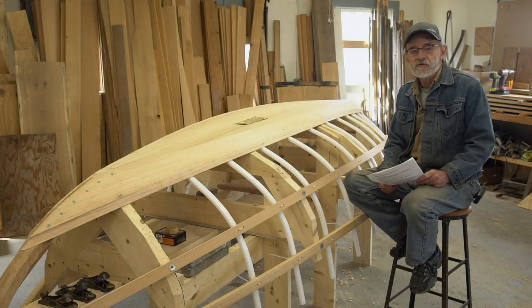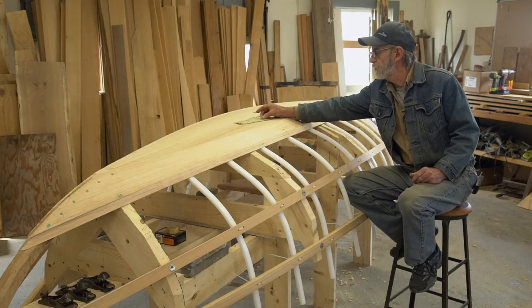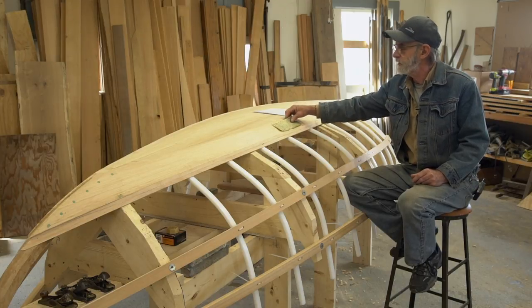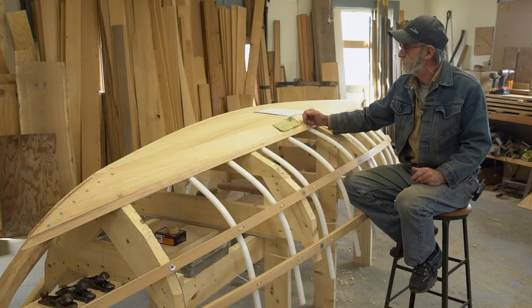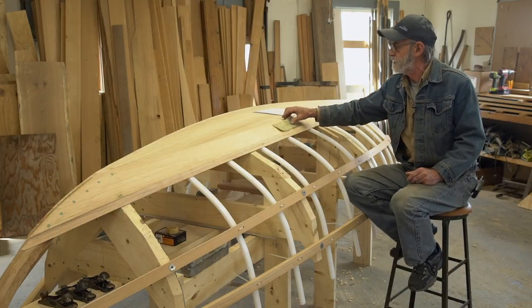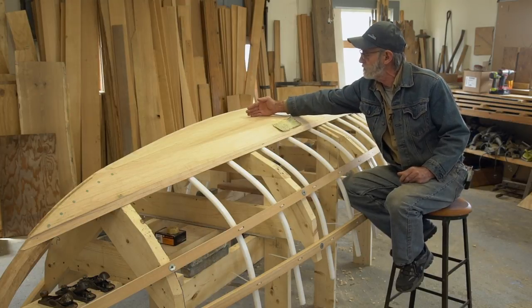The next thing we're going to be doing in our next video is applying some of the Kevlar over the bottom. It's a Kevlar carbon weave, actually. It's a standard weave. I've been kicking this around in my head for quite a while, how in the world I was going to get it cut along the edge of the boat. It would have been very, very difficult if I did it exactly the same way I put the carbon on. So I've decided to put it on in two pieces with a seam in the middle, kind of an overlap right in the middle of the bottom.